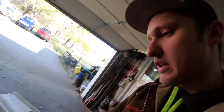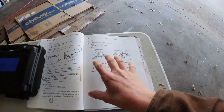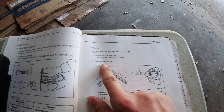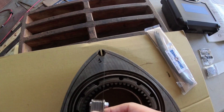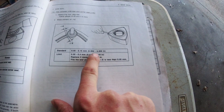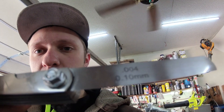The rear rotor is down there with some oil on it to keep flash rust away. We'll look at the book — the Rotary Engine Book of Secrets — your criteria for overhaul. I'll link the book PDF and a related video in the description. The side seal section shows: gap between the side seal and corner seal, measuring tool required is a feeler gauge. The spec in inches is 0.002 to 0.006 — the delta between the side seal and corner seal.